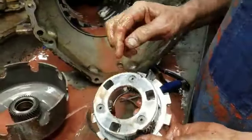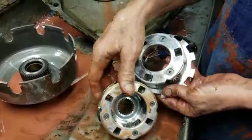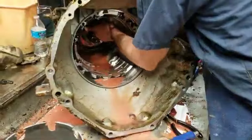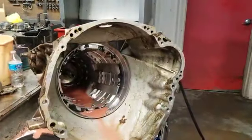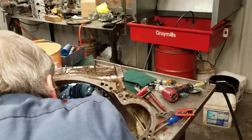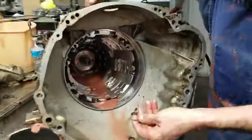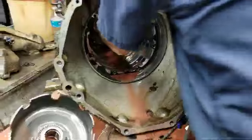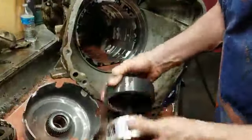The diesel version will have more than three pinion gears. See how this has four and this one has three — the diesel will always have four. This snap ring actually holds the shaft from coming out the back of the transmission right there. It sets in there like that, and the snap ring goes right here.